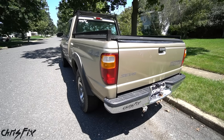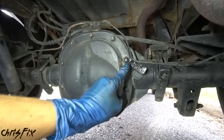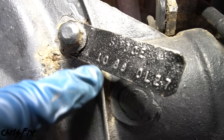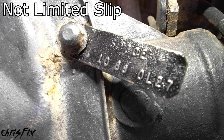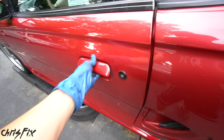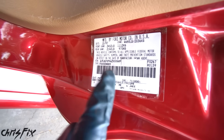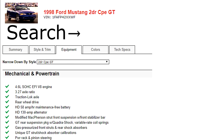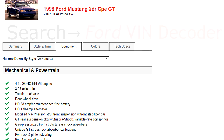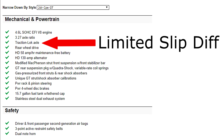For another example, if we take a look under my truck, we have a similar rear end and you can see our tag right there. This tag shows 4.10 gears in an 8.8 rear end, but there's no L here, so it's an open differential. Now, not every differential still has the tag on it, so just go to your door jamb and there is a sticker with your VIN number. Take that VIN number, type it into a VIN decoder — just do an internet search with your car's make and the word VIN decoder — enter your VIN, and it'll give you information including whether the car has a limited slip differential.